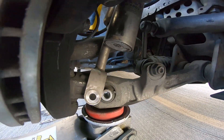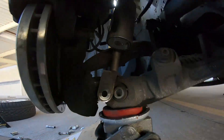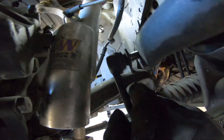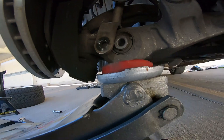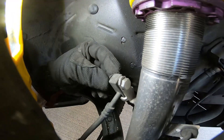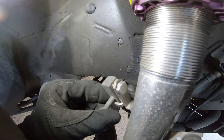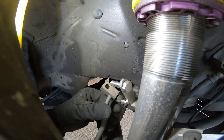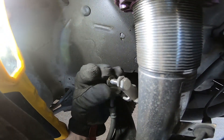Put a little tension on this so it makes that sway bar end link pop out a lot easier. That's why you put a little tension on it. Go ahead and lower it back down. Move this bracket right here and slide that off. Brake on. Then I just put the bolt back on so I remember it.